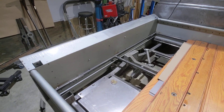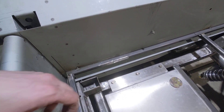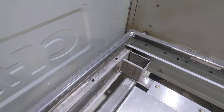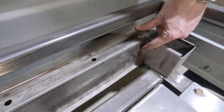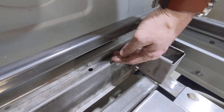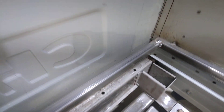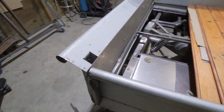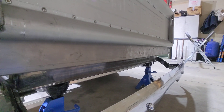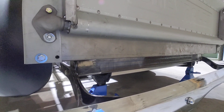I have the bed wood that I need to complete. I laid out the initial frame structure perimeter, but because I raised the bed a little bit to accommodate the C-notches, I have to correct this piece — it's the back of the box structure that normally the bed wood butts against. I need to elevate it and create a larger piece up to the height where the wood's going to be. I already know the design because I previously made a new panel here — all new steel — designed in CAD and had it broke into the correct angles, but I did it the original size, so now I just have to make it larger.